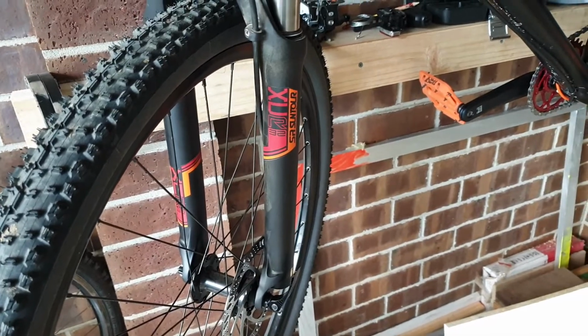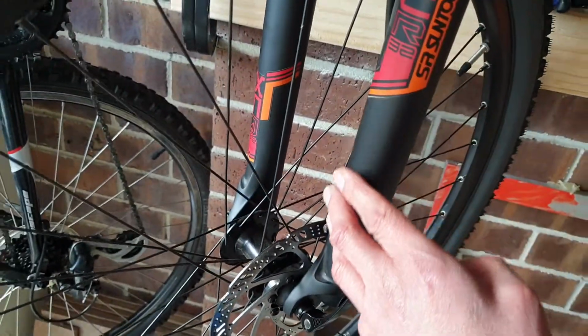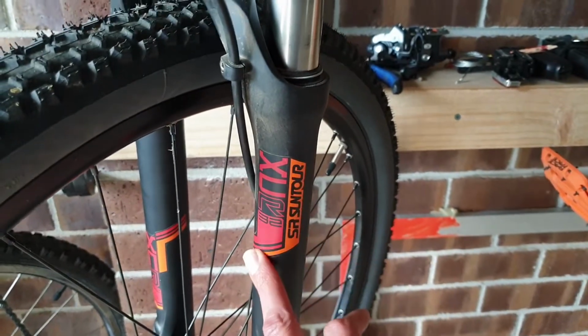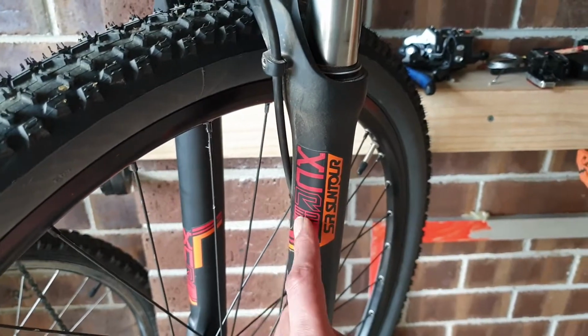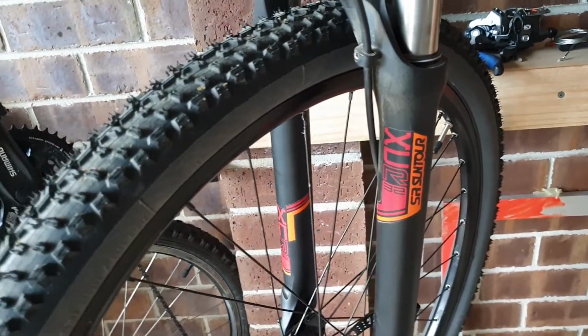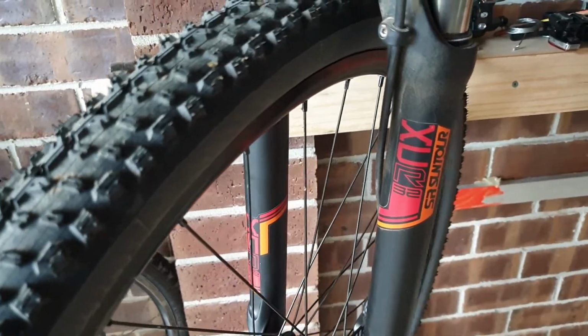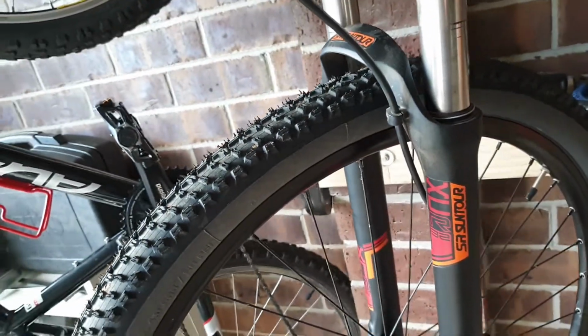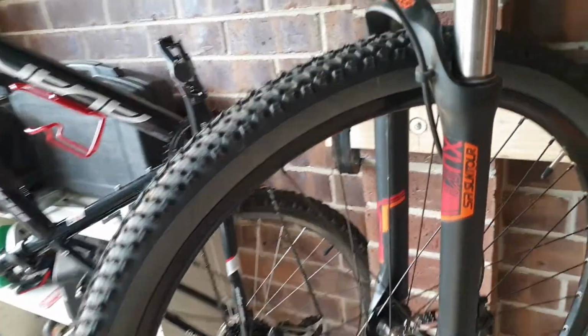They are steel spring forks, and while not bad in their own right, they're probably as good a casual fork as you can get. These are the XCR32 SR Suntour. But they have no rebound adjustment, and I can do better. So I'm guessing about $300 will get me to maybe a RockShox Recon RL, or perhaps a Manitou, or whatever the equivalent is.